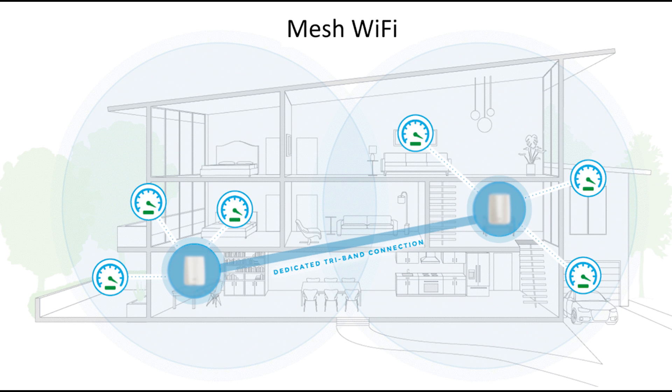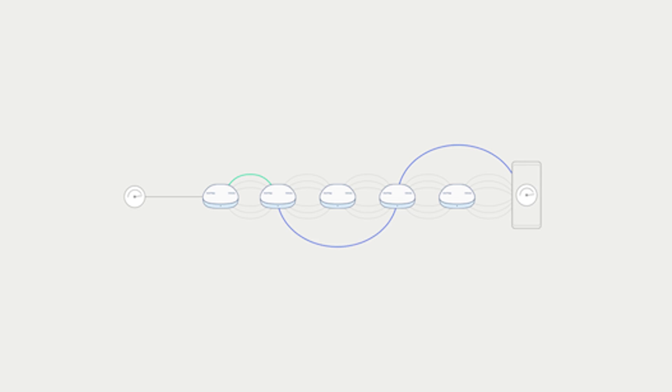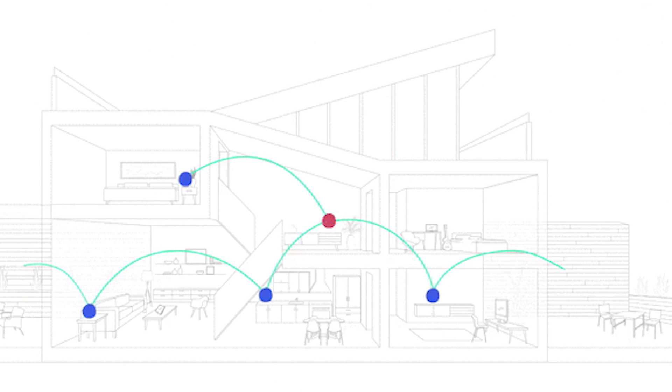Each hub produces its own Wi-Fi network that your devices can connect to in order to communicate with each other or through the modem to access the internet. So let's say, for example, you had 30 hubs all positioned in a cluster — and yes, a lot of these mesh systems support that many hubs; the SmartThings one I'm using supports up to 32 actually. The signal would not just get passed through the hub you're closest to, to the next one, until eventually through to the main hub connected to the internet. It'll actually find the fastest way through the other hubs to do so, even if that way isn't the same every time and they use a different route. For example, if there's traffic on one of the hubs and it's being over-utilized, it can actually skip that hub and use another one that's nearby.